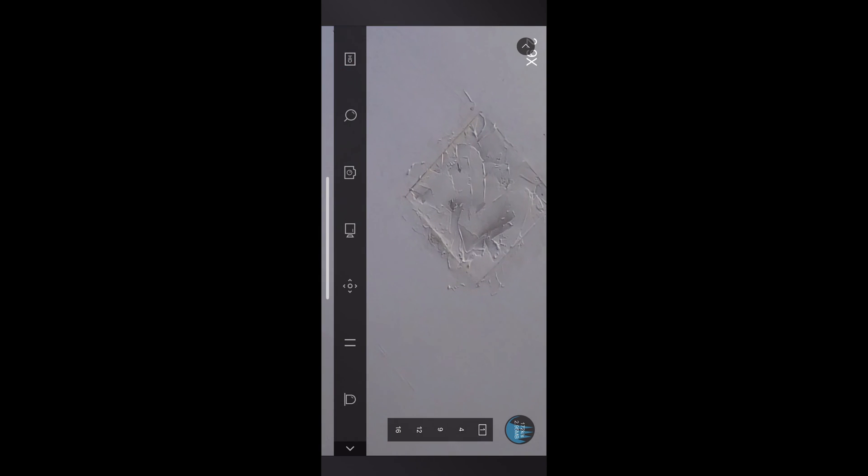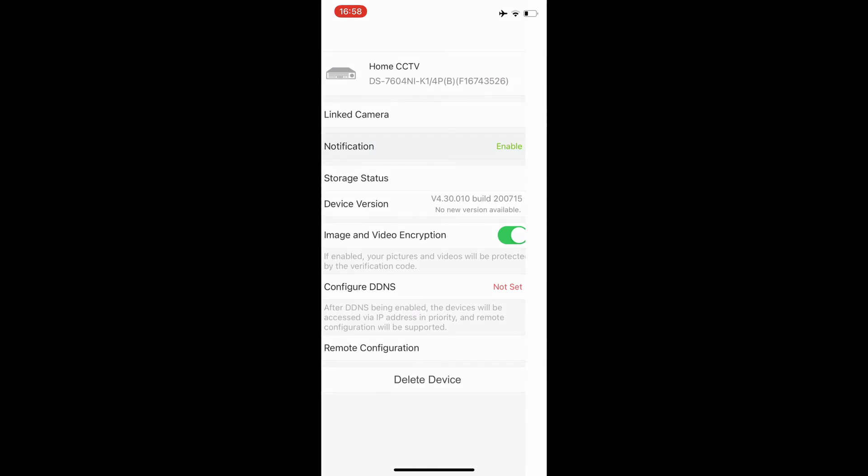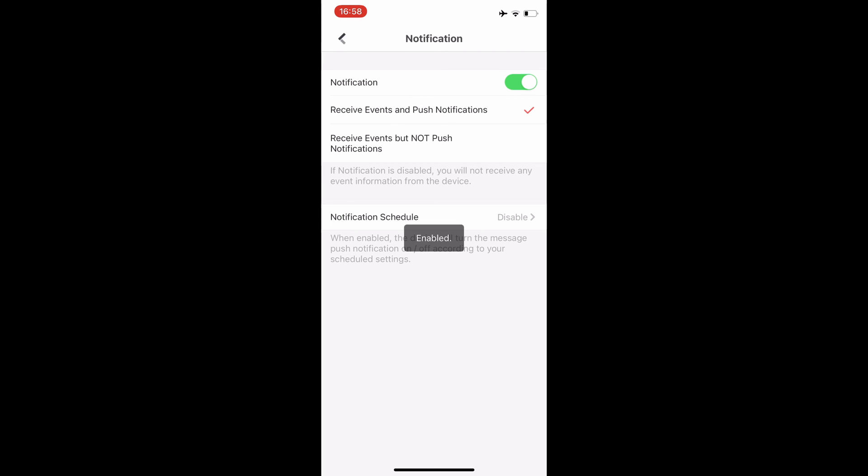Normally on the bottom left corner it'll say basic, not HD. In basic mode it reduces the overall quality of the image but loads a lot quicker — especially useful when you're on 3G or 4G. If you're on Wi-Fi, let's change it to HD — it'll be a lot sharper, and if you've got audio you'll hear it in HD mode but not in basic mode. Put your phone into landscape mode and it'll fill the screen nicely — you can pinch to zoom just like a photograph. Let's go back. If you want motion detection notifications on your phone, go onto the settings page, click on notification — normally it'll be off by default, so if you want it on just press on. And that's that.